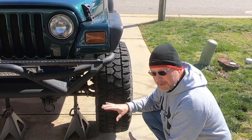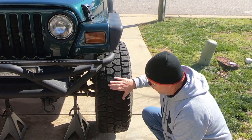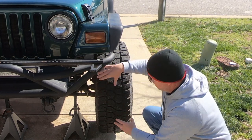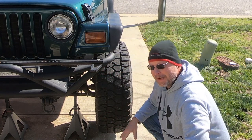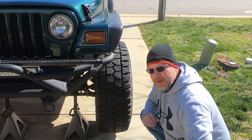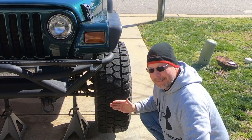It is inaccurate, it's wrong, and I'm going to tell you why. You can see we've already got Grunt here jacked up. If you look at the tire the way it's sitting — when you add a wheel spacer, you're moving the wheel out this way. Well, guess what? That's the exact same thing that happens when you change the backspace on your wheels. It's no different than backspacing your wheels. It's the exact same thing.